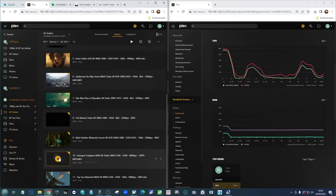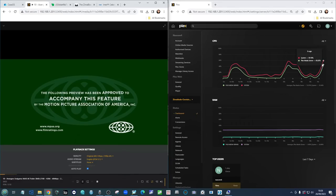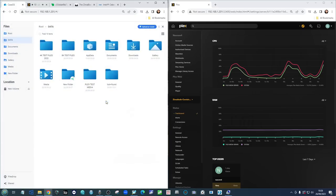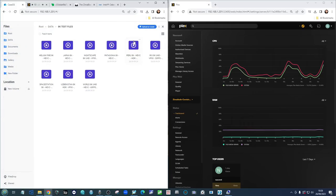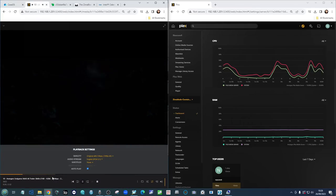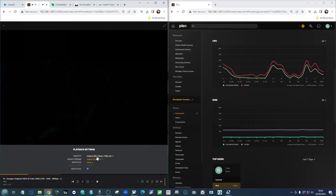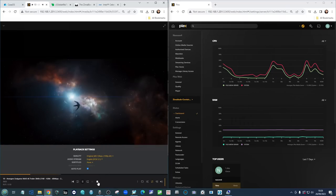Although we're not seeing buffering massively outpacing playback, we're still seeing pretty good numbers, though that CPU spike appears again. For those doing simultaneous 4K file playback natively via different client devices, bear that in mind. The Avengers Endgame file at 40 megabits per second — even at 49 megabits per second — is playing absolutely fine, slightly undermining my earlier prediction.